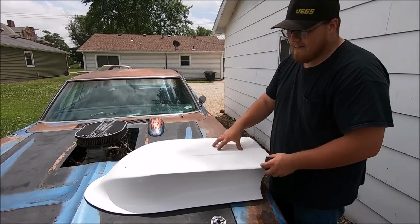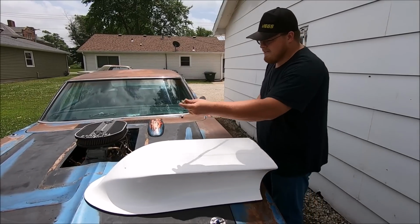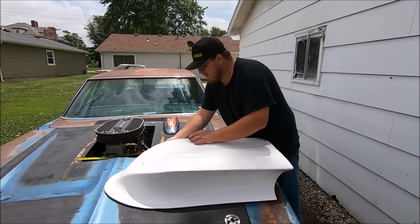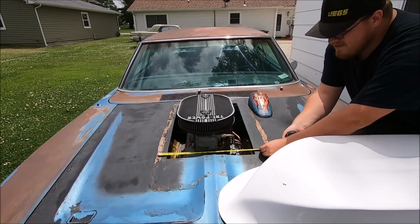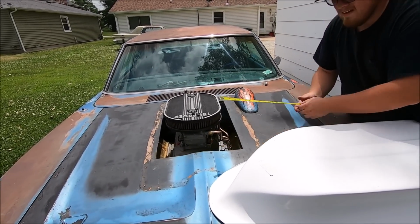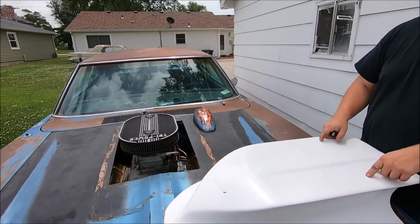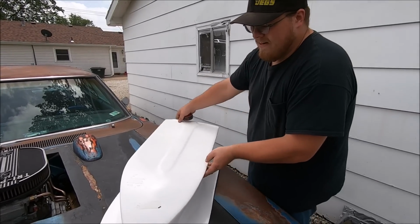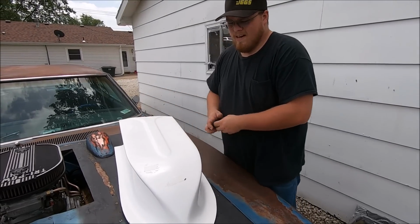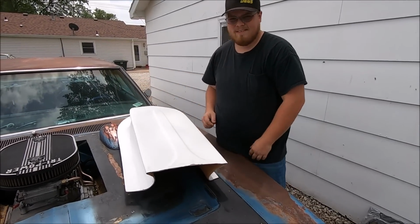And this thing will be black. We're gonna repaint the hood to match it. But yeah, we want to go with Jezebel's old flange here. It's close to 21 inches. So that would mean widening this with a 5-inch strip, so we need to cut a 6-inch strip out. That's this length. I think it'll look pretty sweet, and hopefully it does because we're actually going to put this thing on like this.